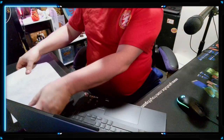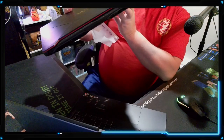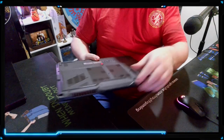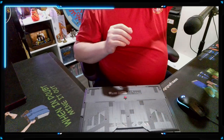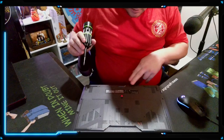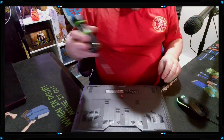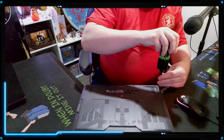So this laptop, the newest one, only has two regular USBs and two Type-C USBs, whereas its predecessor had three USB ports and a Thunderbolt port. Before I even boot it up, I want to open it up right away just to verify that it has all the same available ports as the other ones before I order new parts. We've got four screws on the bottom, three in the middle, four on top — let's see if we don't have the same issue with the one screw that doesn't want to come out.